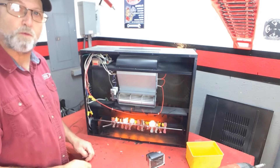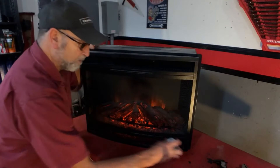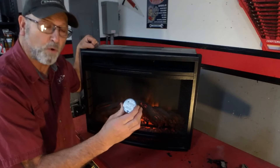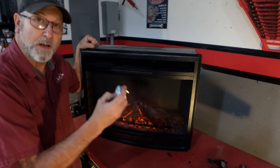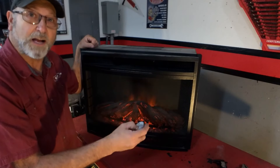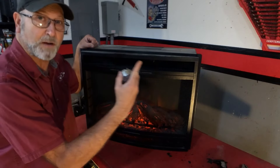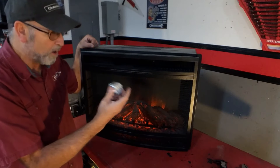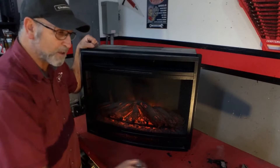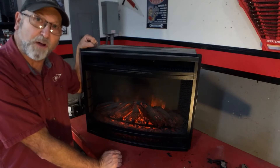Go ahead and put it all back together, spin it around, and we'll take a look at it. There she is, working like a champ. That's all it was — that motor. This is the second one I've had to repair. The hardest part about the whole project is finding the right motor. You want to make sure you get the right one when it comes to whether it's counterclockwise or clockwise. If it's clockwise, the fire is going to go backwards. If it's bidirectional, it's going to act like your microwave — sometimes going one direction, sometimes the other. So it's important to get the right motor for the project. Also pay attention to the voltage — this is 120 volts AC. Other than that, that's pretty much all there is to it. All I need to do now is put this back into the furniture and it's ready to rock and roll. Thanks an awful lot for watching and we'll see you on the next one.